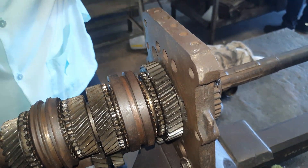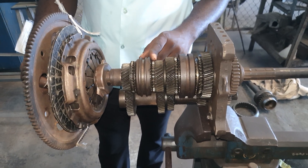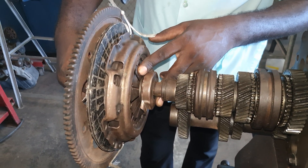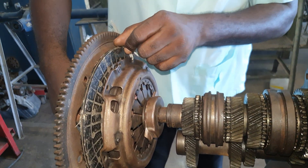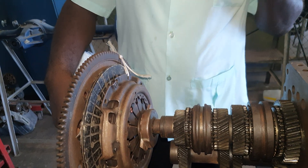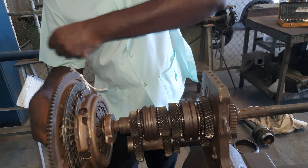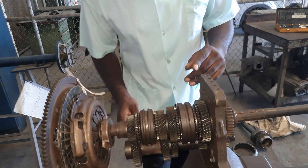When the vehicle is driving and it's in gear, everything is okay. When the driver decides to change gear, he will first have to activate the throwout bearing. This throwout bearing will press against the pressure plate and release the drive from the flywheel to the clutch, so there will be no engine drive going to the gearbox. The gearbox will then operate from momentum — similar to spinning a gyroscope and having it keep spinning. That is what we call momentum.